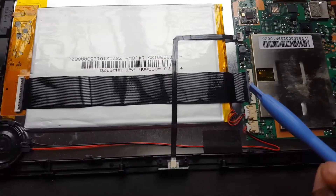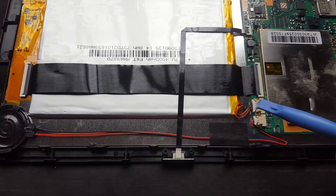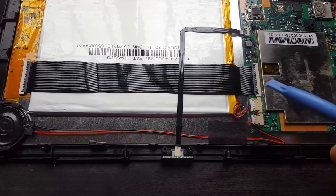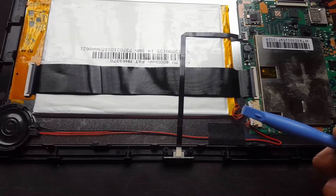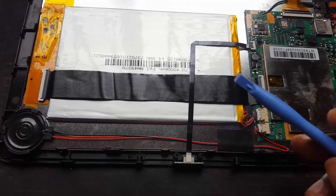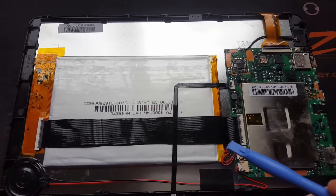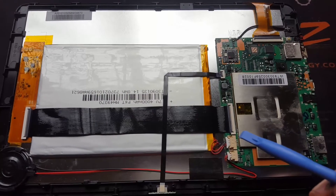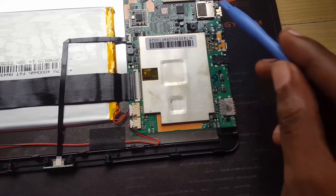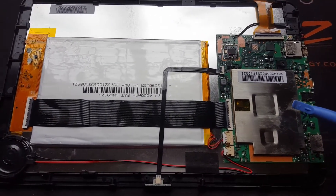Back to the battery — you'd have to flip this ribbon cable up and slide it out, then move this one out of the way, and you can change the battery. If you just want to disconnect the battery due to power issues — such as the device not powering on and the display being blank — just eject it and leave it out. Press and hold the power button, then reconnect, and in most cases it should cause the tablet to start booting again. This is a very simple tablet, very easy to repair — I give it an eight or nine for repairability.